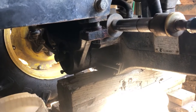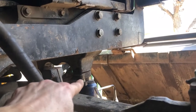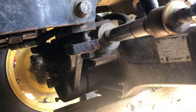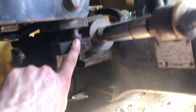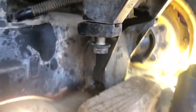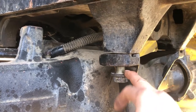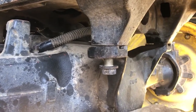On this axle you've got four bolts on each side — one, two, three, four — with a heavy-duty 29-millimeter head. Getting them off is the biggest issue. I had to heat a lot of them to break them loose, then use an impact driver while still hot, and then a socket with a wrench and an extension to get some of them off.